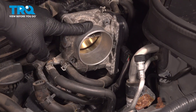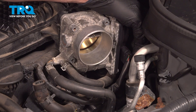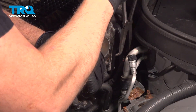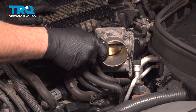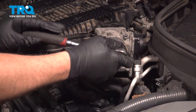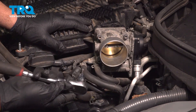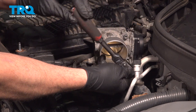Now that we have all the components removed, we want to go ahead and remove the throttle body. There is a connector for the unit — there's a tab on the back side. Push down on this and pull the connector off. It's a little tough to get to, so you can use a pair of pliers to gently pinch that tab and pull the connector off. Slide that off. Using a number 5 Allen key, loosen the bolts for the throttle body. We have not disconnected any of the coolant lines — we're simply going to unbolt it and pull it to the side to gain access to the 10mm bolt holding the ignition coil in place.